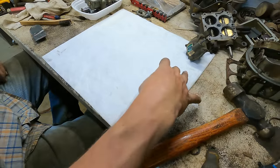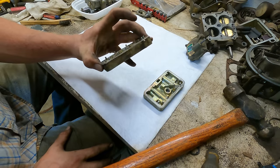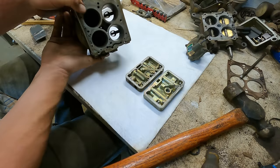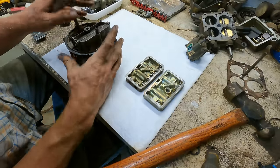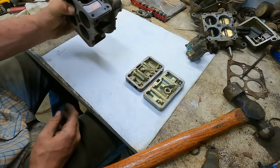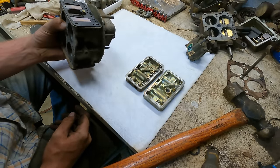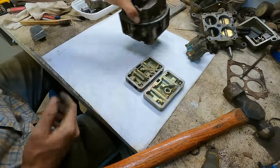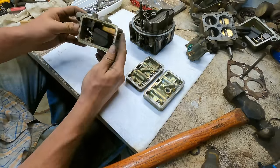Well, everything seems to be about as clean, internally anyways, as it's going to get. I think it all looks pretty decent. It really wasn't bad at all. Like I said, I probably just had some water frozen in the line and it wouldn't pick up any more fuel. That's my guess. But this was a learning exercise, as I stated. Glad I did it.